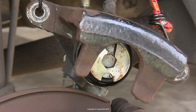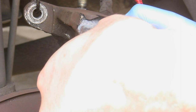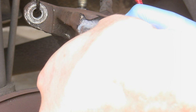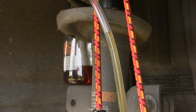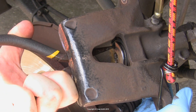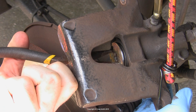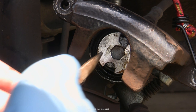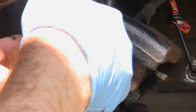To do the retraction you need a tool to push and turn the piston. On this caliper I was able to just use needle-nose pliers — it was rebuilt recently and the piston still turns easily. The left caliper needed turning counterclockwise, and as you can see, as it retracts the brake fluid is getting pushed out the bleed valve into my little kit. You want to wind it all the way back as far as it will go, especially if you're replacing both pads and the rotor — the piston surface will end up close to flush with the surrounding caliper body. Finally, the piston must be oriented correctly: on the left side there is a circular opening to be aligned with the little nib on the inside of the caliper body.